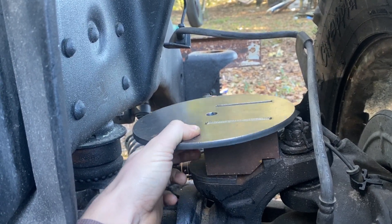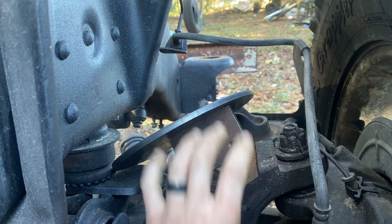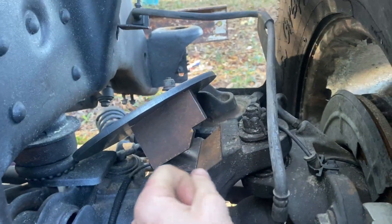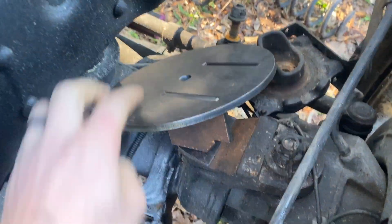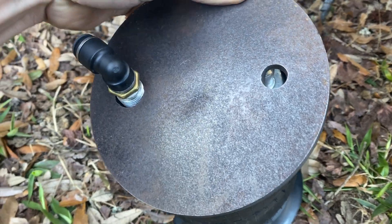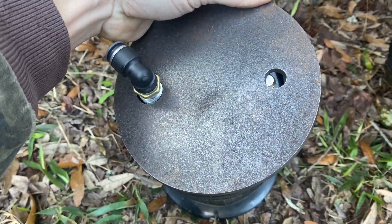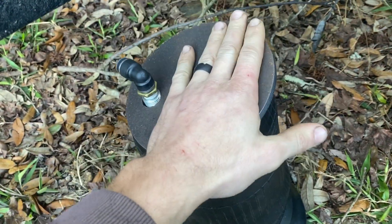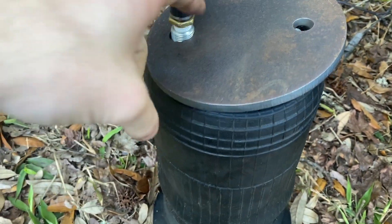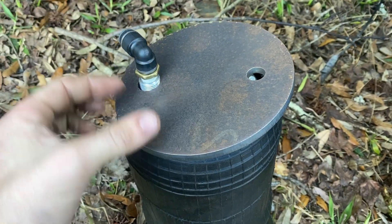This piece will get welded to that, then the whole assembly will be bolted to the knuckle or the axle itself so you can unbolt it to change ball joints and service it. The single bolt hole lines up with that bolt so it'll be bolted in. I'm going to have this recut as well — my bolt hole center width is off about half an inch. The bag will bolt to this disc and I'll have some metal bracing or DOM tubing inside, welded to this piece.